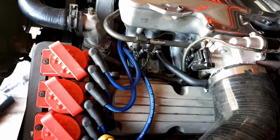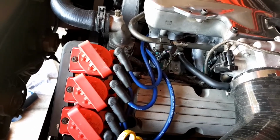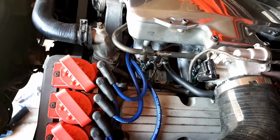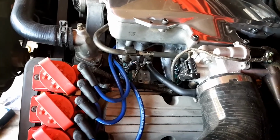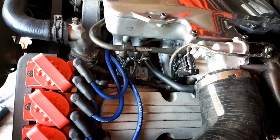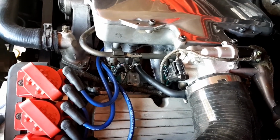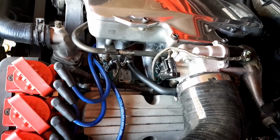So I've had this running, everything seems fine. I did mention on the video I thought about putting RTV around the water jackets on the inlet manifold gaskets, but I'm glad I didn't do that because they just fail. It's got nothing to do with the sealing, it's just the rubber bit fails or the plastic warps, and that's why they fail. So I guess the steel ones are a better option, but I got a horrible feeling I might have to replace the inlet manifold at some stage because it had a lot of pitting on it, and I got it as good as I could.